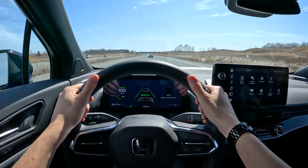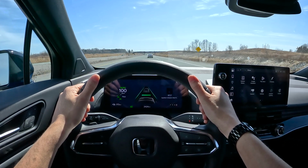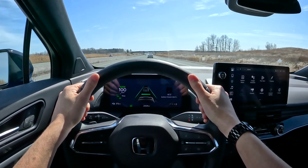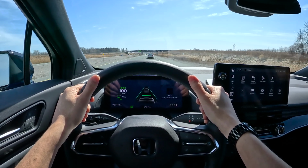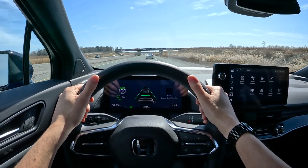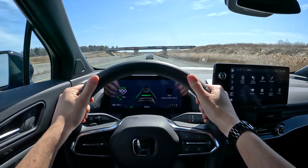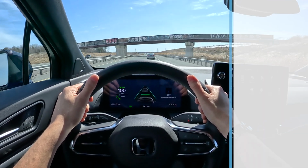So those are things you have to factor into the equation there of whether you even look at investing in a home charge station. Just knowing you could be okay with level 1 charging, so a regular wall plug, if you're only driving a few kilometers a day or a few miles per day. You might want to invest in a level 2 if you're going, I'd probably say 50 to 100 kilometers or around 40 to 60 miles a day for driving habits.